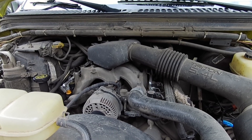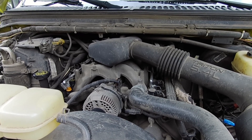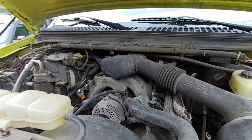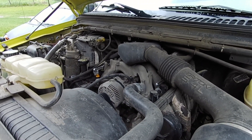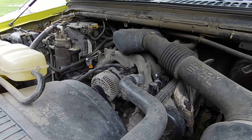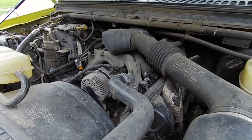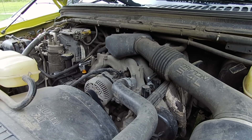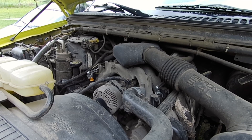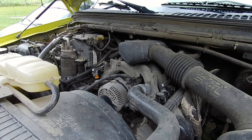So you don't want to be running a really thick oil in it. This engine currently has 10W40 in it — that's what the previous owner had put in it because it was using some oil, and it's making some noise; it doesn't sound too healthy. So we're going to try putting some 5W30 in it and see if that improves anything. It might be due for a new engine, but you want to put either 5W30 or 5W20 — a lot of people are running 5W20 in these. Definitely don't go any thicker than 5W30.